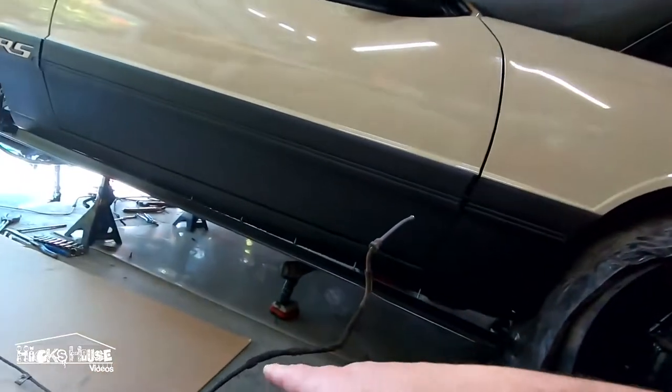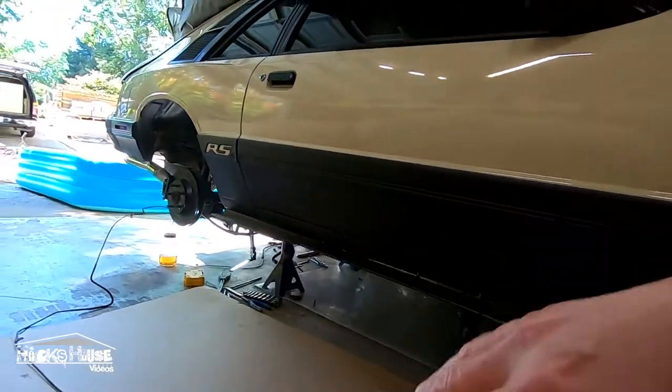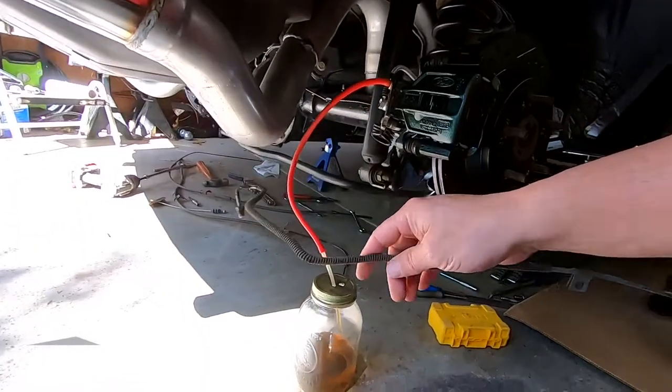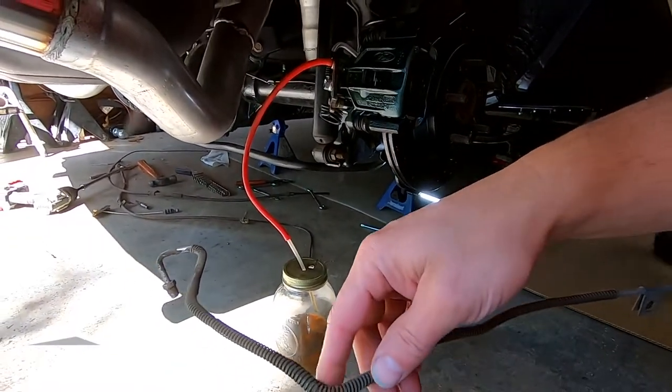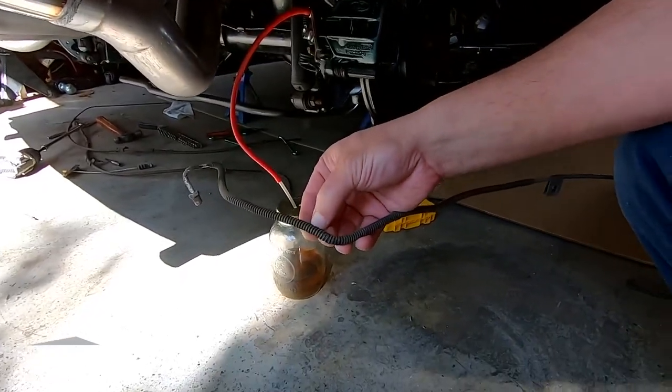So please check your brake line — you can see it's rusty right there. And then back here at the back it was a little not quite as bad, but it was just corroded and junky, because these springs can get corroded too and cause rust.